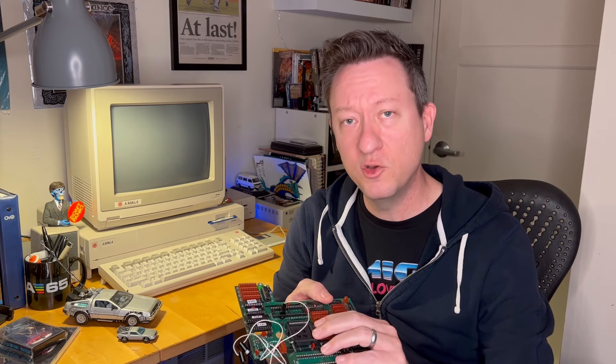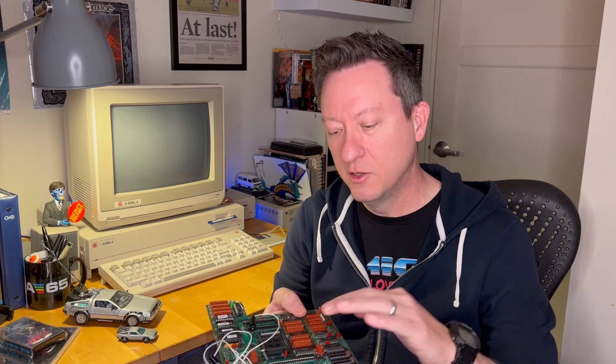What do I mean by that? Well, remember this video port? This is really an antiquated, kind of obsolete video port. Realistically, in today's world, there are a lot of much easier, cheaper ways to get high quality video out of an Amiga onto a more modern screen. And so one of the things that people are already starting to talk about and focus their attention on is how to update this into a more modern package that might export HDMI signals. Or how to update the Agnes to not use the really hard-to-find Amiga 3000 Agnes — which are expensive if you can even find one because they're so rare — but to use the much more common two megabyte Agnes. Work is already being done on that, where you might actually have a jumper that allows you to select between the really hard-to-find Agnes, the more common two meg Agnes, or the much more common one meg Agnes. That kind of stuff is being worked on.